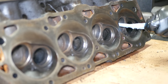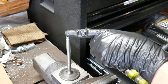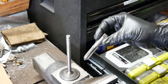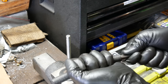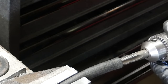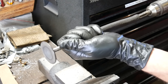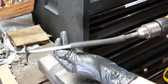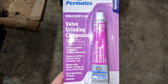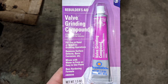Once everything seems clean enough to proceed, we'll put together our valve lapping setup. Here's an intake valve, 3/8 inch fuel hose, and a 1/2 inch tap. We'll thread that as far into the hose as we can get it, and then chuck the tap into the drill. Hand lapping is great and all, but when you need to remove as much material as we do here, you would probably be there for weeks doing that. We'll also need a fair amount of valve grinding compound, and this Permatex is what we'll be using.